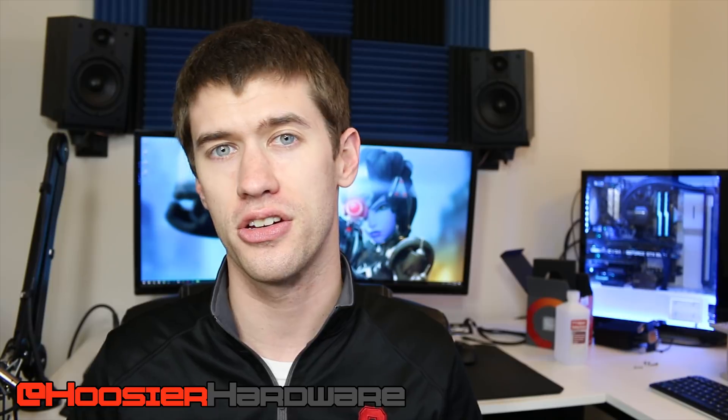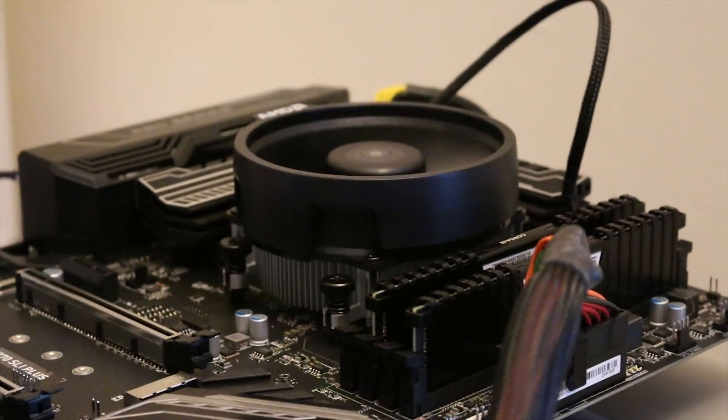Welcome back to the channel. Some time ago I bought a couple of Ryzen APUs — both the R3 2200G and the R5 2400G. The cooler those chips ship with is the Wraith Stealth cooler, which is very low profile and tiny — great for HTPCs — but also very low on cooling capacity. One of the nice things about Ryzen chips is that you can actually overclock all the different SKUs, but with such a puny cooler, and the IHS on these chips not being soldered like other Ryzen chips, it leaves a lot to be desired.